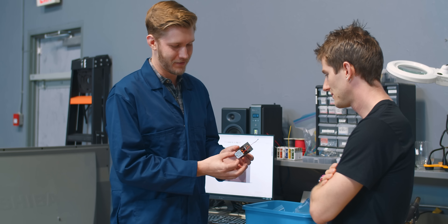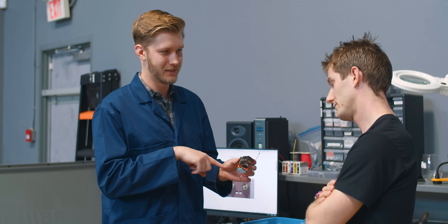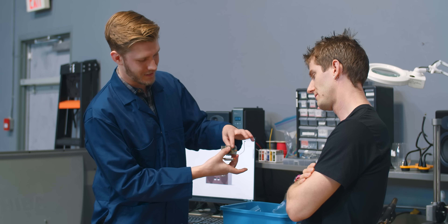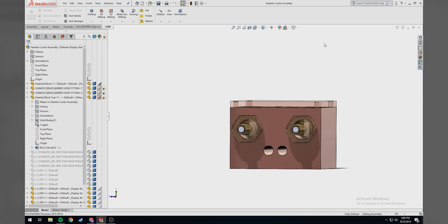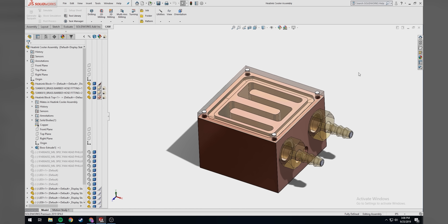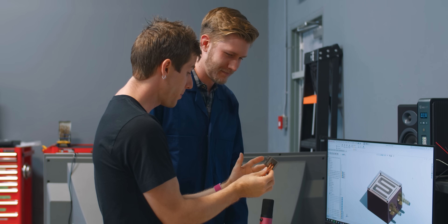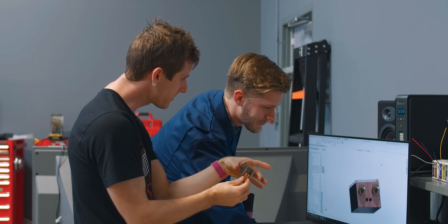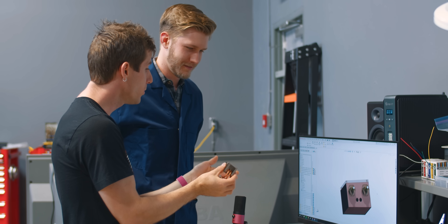This right here is the really difficult one that we have to do first. The plan is to chop all of these fins off and then create a super small water block that just fits on here, with the fittings coming out the back. We have to consider that all of that is within about this big. We chop all the fins off but leave the pipes, and that block slides onto the pipes through these holes. So we are effectively water-cooling the heat pipes.